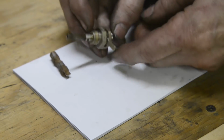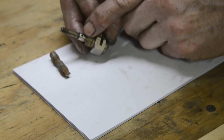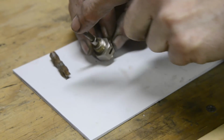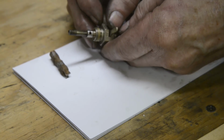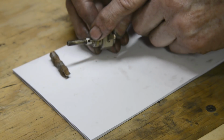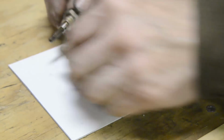Now, when that's over here in the ordinary position, this little hole here is just up against the wall of this tube. So the fuel will only go down until it gets to there. But then when you move this over, I don't know if you can see that, can you see it? You'll line another hole up so that it'll actually feed through that way. Isn't that clever?